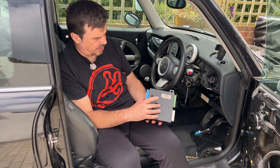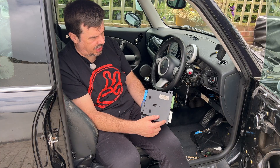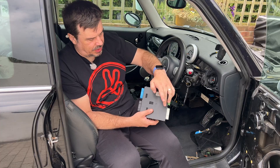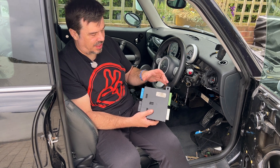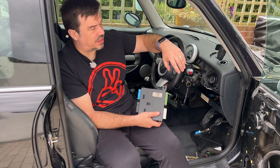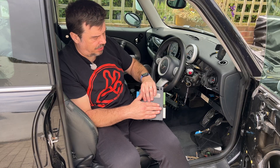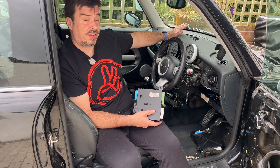Then I thought: I can disconnect these sections and find out which section of KBUS wiring is at fault. According to the wiring diagrams, the blue connector deals with wiring to the dash area, and the white connector deals with wiring to the accessories or options - and they meet up in the BCM unit itself. So I disconnected the accessories side, which meant all external lights wouldn't work but all interior stuff should. When I disconnected it and switched my indicators, the telltale would light up but nothing on the exterior - which led me to believe some of the wiring going to the accessories is at fault. Which meant I'd ripped out this entire dash for nothing - a minor problem.